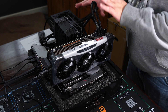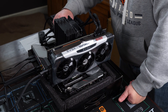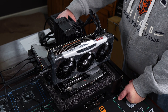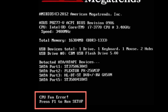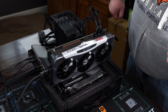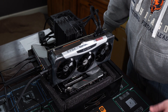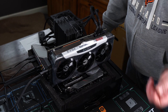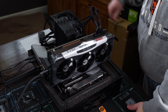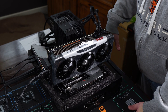After you've eliminated all power cables as a culprit, check your CPU fan header cable — make sure that's plugged in. Normally if it isn't, you'll just get a CPU fan-not-detected error. This can also happen if you're doing a full custom water loop, in which case it's not really an issue, but you'll get that warning every single time you boot. You'll want to go into the BIOS and disable that warning.